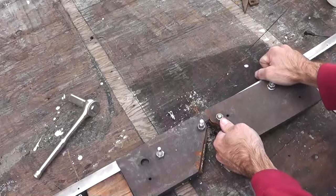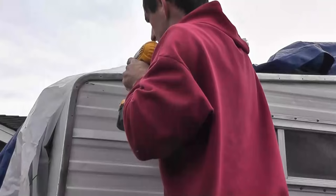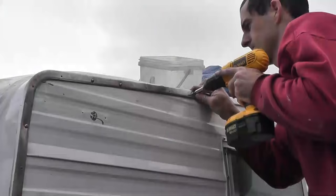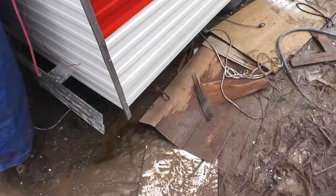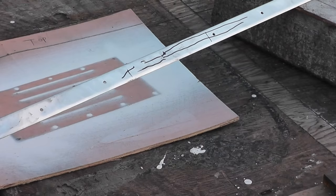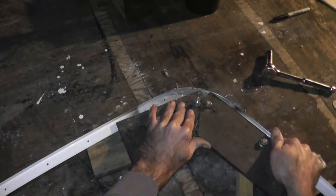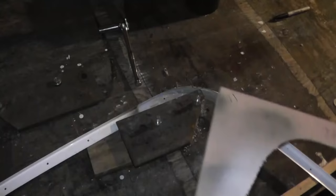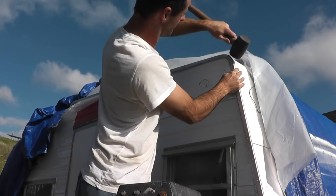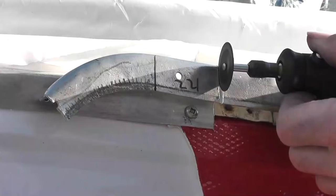I think the bends are close enough that it will work. Time to attach the trim to the trailer with some screws — I'll start up here at the top. This is just a preliminary installation to verify proper fit, so there's no butyl tape applied and I'm not worried about getting screws in every hole. I think it'll work. Next I'll move on to the front piece. Luckily, that curve is not as sharp as the rear, so I just need to measure, anneal, and bend. Shaping these pieces of aluminum is the type of job where I knew nothing going in, but by the time I'm finished I'll be an expert — and I'll never use this skill again in my life. Hopefully.